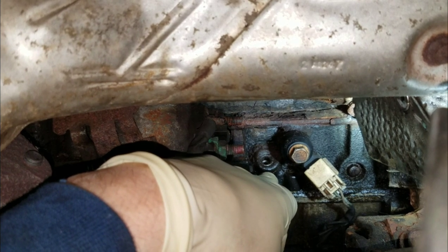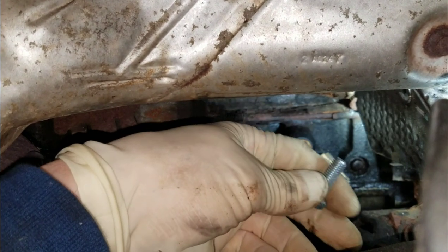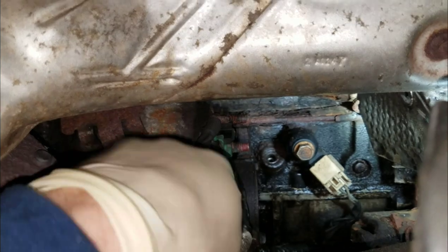First, I'm going to take some heat to this. I'm going to use the torches and heat it up because there's a rubber O-ring in there that usually keeps this thing from being able to pull out. So we're going to heat it up and hopefully melt that rubber O-ring a little bit and loosen up some of this rust. Then I'll throw this down in the hole and attempt to remove that piece.